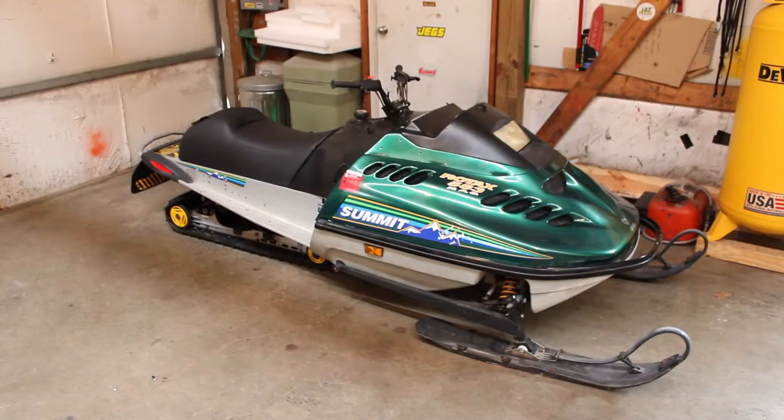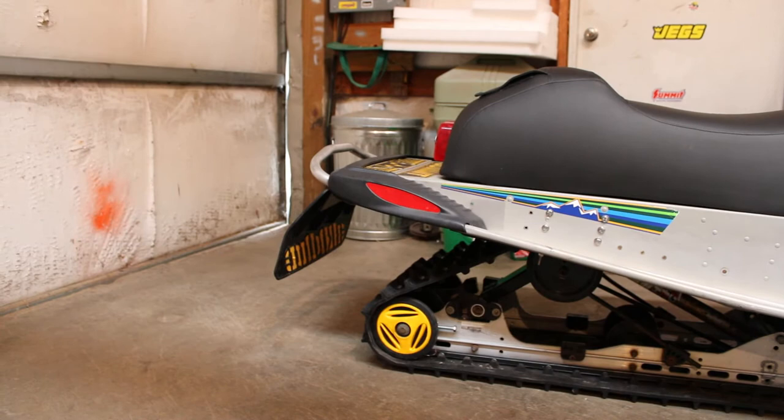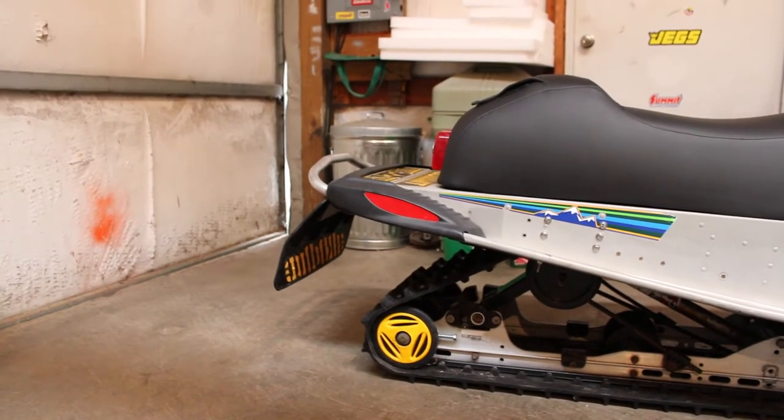All in all, not a bad job — pretty quick actually. You can utilize the existing front mount holes on the F-chassis. With the C7 you would have just had to move the rear mount brackets forward to meet the center-to-center distance that the SC10 requires, but I got rid of those altogether and used the brackets off the Renegade chassis. The center-to-center distance was like 30 and 5/8 inches. That lined up damn near perfect and it seems to function well — you saw me hop up and down on it and it rebounds pretty good. We definitely gained a couple inches of height in the rear. And while I was at it I also swapped out the rear grab bar, all the plastics on the end of the tunnel, and the snow flap.